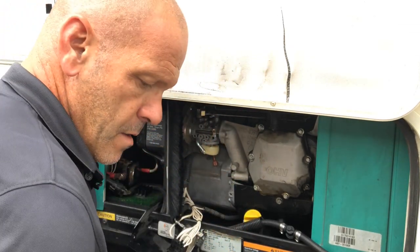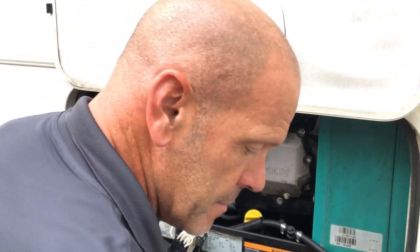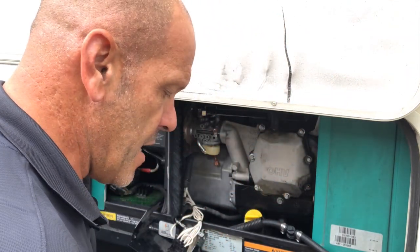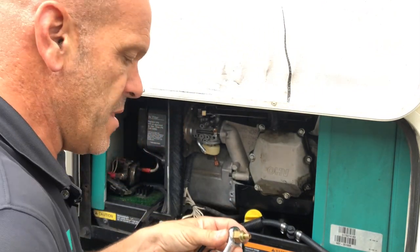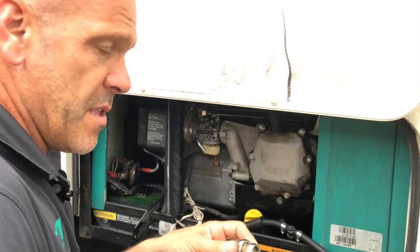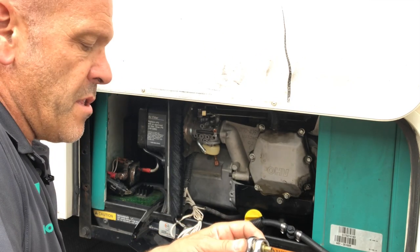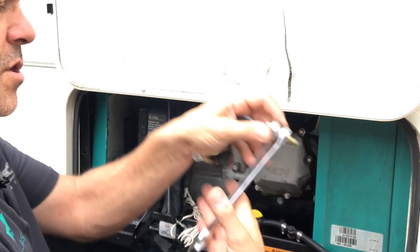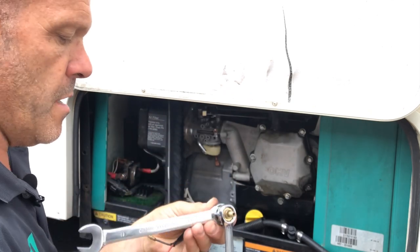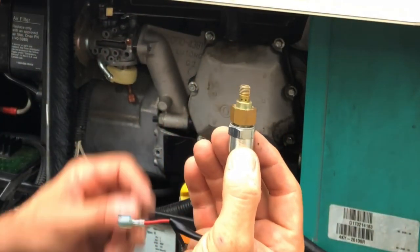Okay, and we're going to break it apart. When I say break it, I don't mean literally break it. I mean, we'll take our 19 or 3/4, whichever you want, and we'll take our 17 or 11/16, whichever you want, and we're going to separate these two. Just put the two wrenches together and squeeze them, and it will come apart. Hold this up. You don't want anything falling out when you take it apart.